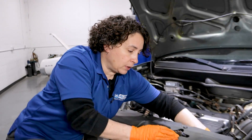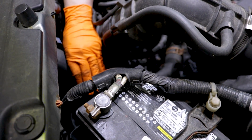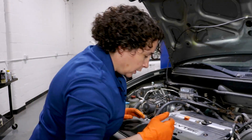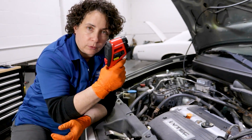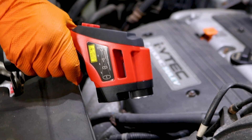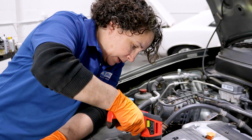Feel the upper hose — carefully grab it right up here. You'll feel that it's hot. If you don't have a temperature gauge, you can aim one and check your temperatures. Then check the lower radiator hose down below. You can also check it with one of these IR thermometers — this one has a red light on it so it tells you right what you're hitting, and it'll give you the temperature. Same with the lower hose; make sure you're aimed right at it.